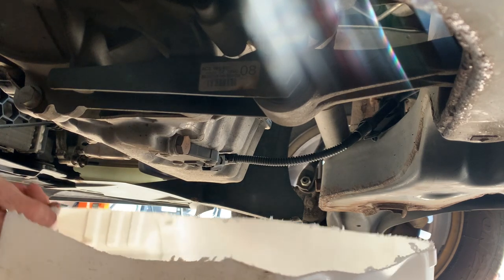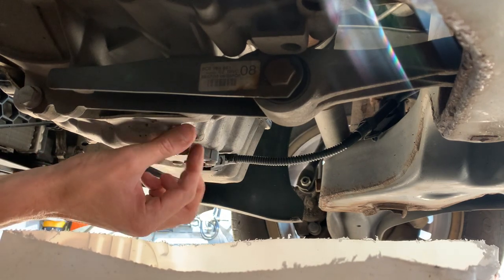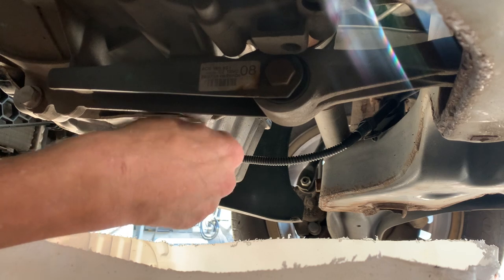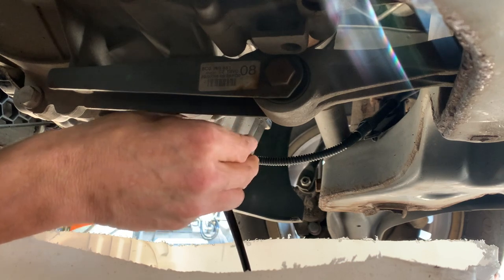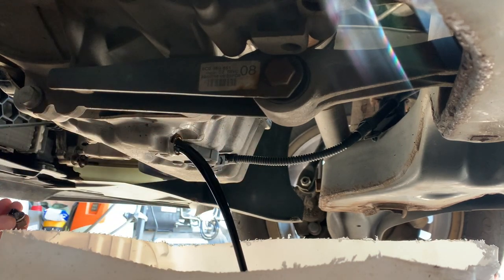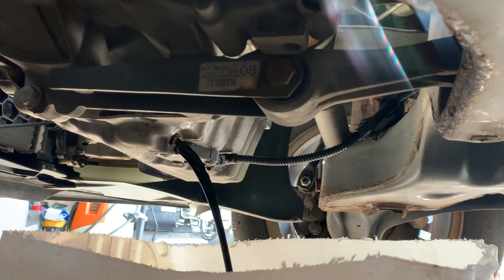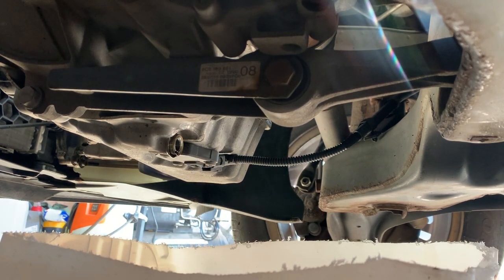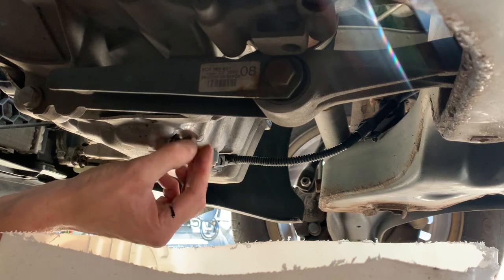It's just a chopped plastic tub I'm using today. So we'll just let that drip away. So that's been dripping away for a while. New washer on the sump plug, so we'll just put that back in, tighten up, and then remove the filter.